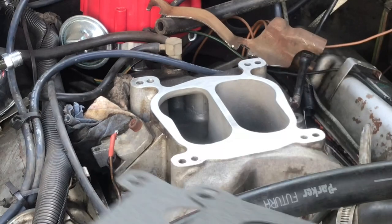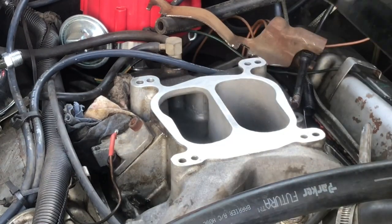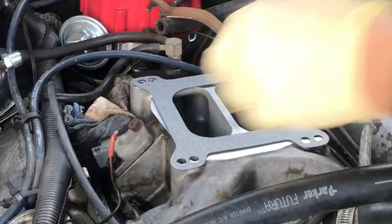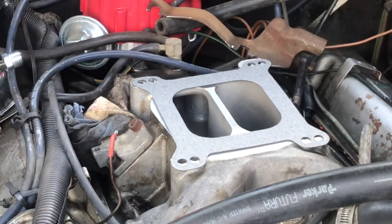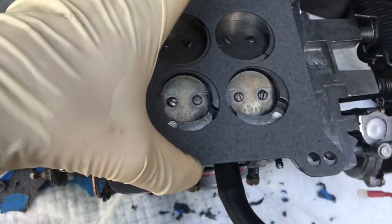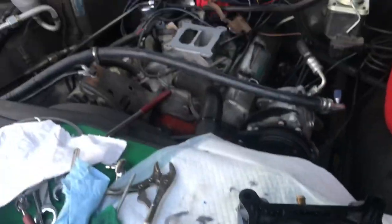Here's my thought process: I've got a round bore gasket, so I think the bore should stay up top and this should go down to the bottom, right? I want to make sure it all fits on the carburetor. I think what's good here — all the holes are lining up good, so I think that's what we'll do. Let's get those studs in there.